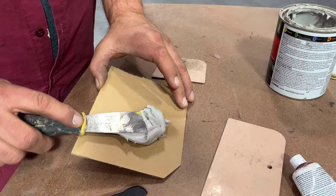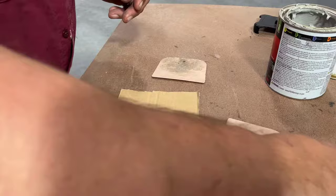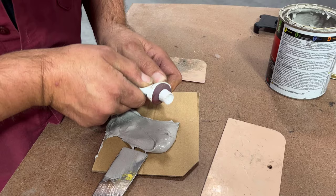If you're going to have too much or too little hardener in the bondo, I would take too much. Not enough hardener means it will not harden or cure. If you have too much hardener, the bondo will still harden, however it will set up very quickly and you won't have a lot of time to work with it.